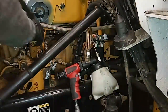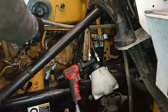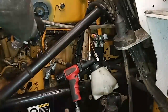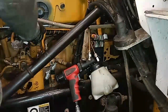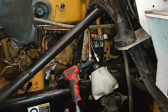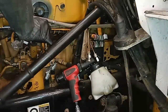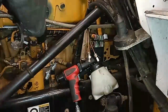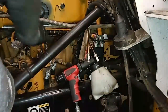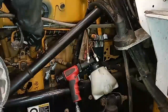There's only going to be a little bit of air left in the system, but all the injectors and everything should be full of fuel. Now is the point where we're going to use our hand priming pump — it should only take a couple of pumps, probably three or four, before we get a full pump stroke of fuel. Once it gets very difficult to push, that means it is full of liquid, which is fuel. Once you push it through the regulator a couple of times when it's super hard to push, you know the entire system is pretty much primed.